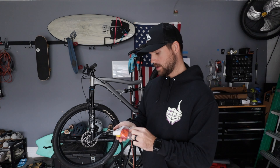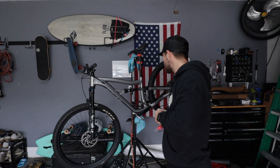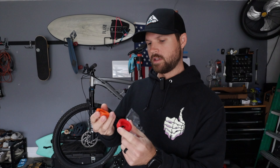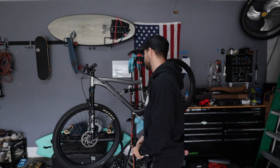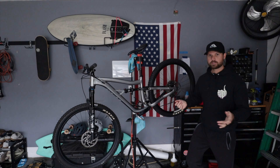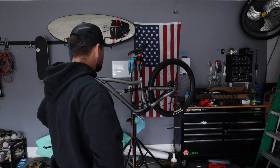I think I'm going to go full big and put the red one in. The red token is 0.95 inch and there's also an orange one. The bigger it is, the more volume you're reducing. The decision will probably be based on what's already in there. I probably want to go red the way I ride, and we can always switch them out — it's not that hard of a process. Everything is red: red gloves, red bars — let's go red.